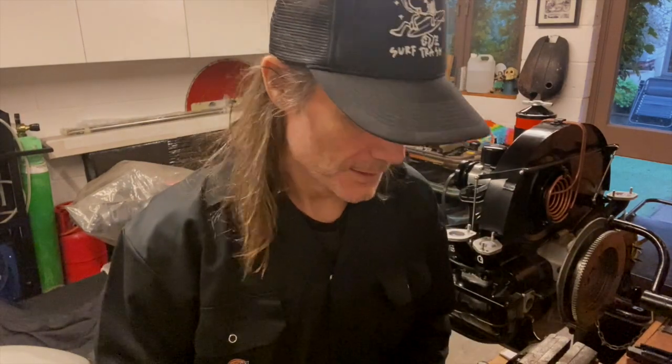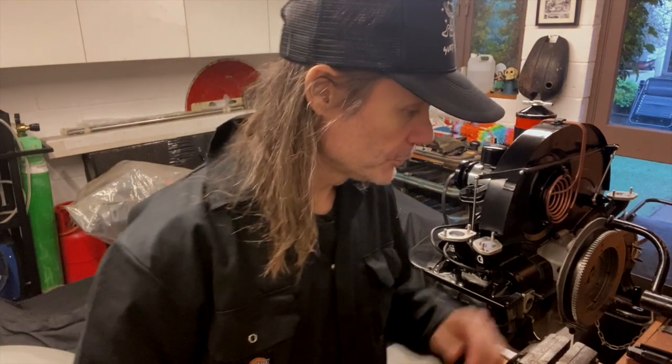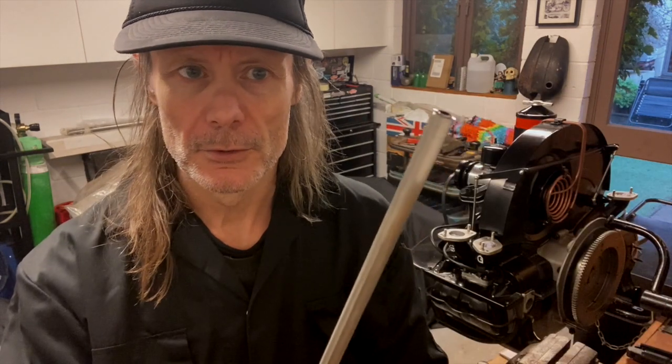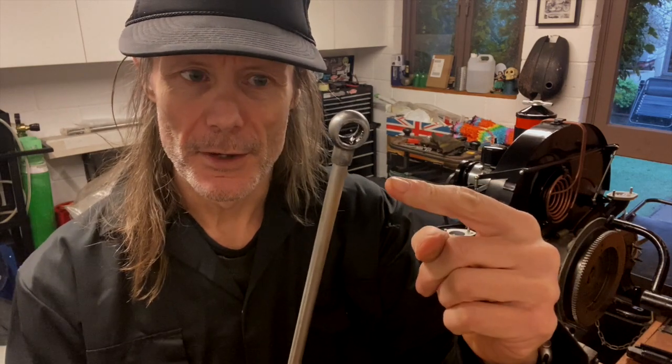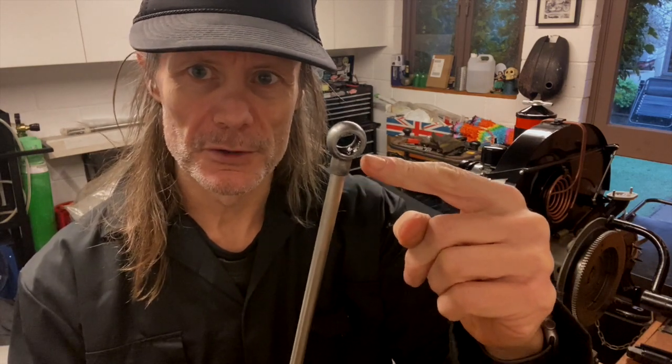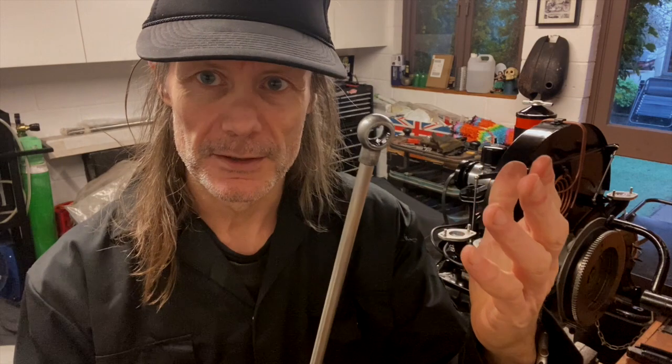Hi, welcome to Aircooled Anything. Today I'm working on my Aircooled motor - I've only got a few jobs left to do on it, one of which is build some fuel lines. Today I'm going to be silver soldering a steel banjo coupling to a stainless steel fuel line. It simply goes on the end, you put solder on it, the solder draws into the joint, seals it, and you have a lovely looking fuel line.